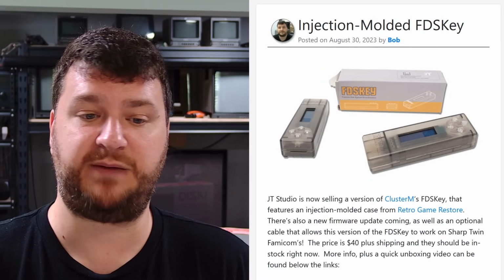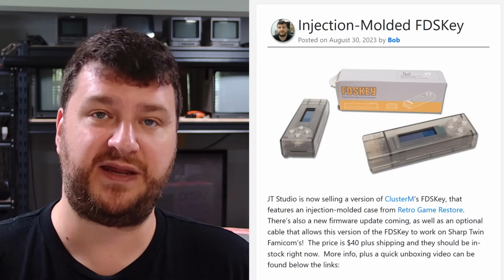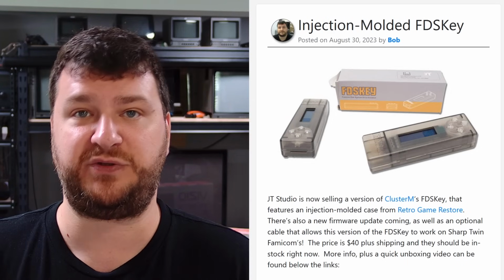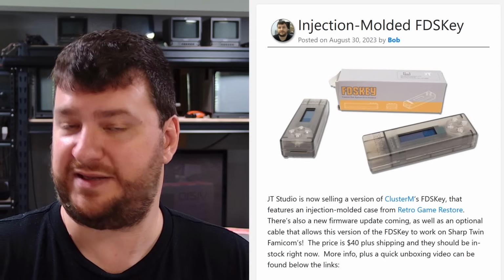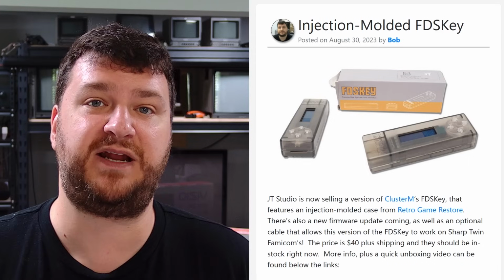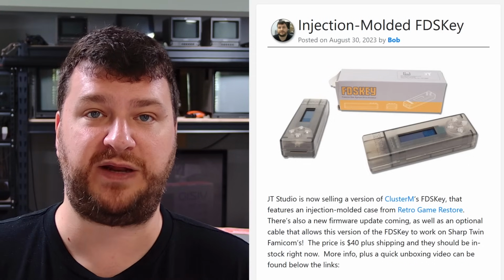You even select your games right on the screen built into this, then power on your system, and what ends up happening is it's a very accurate recreation of the original because you're still using the RAM module, and the only thing you're emulating is the game data, the disk data, not any of the chips that are on the RAM module. So for people that just love having their full setups, or for purists that want something a little bit more accurate, this is probably the way to go.